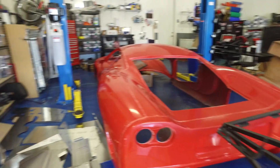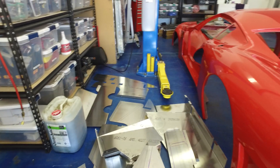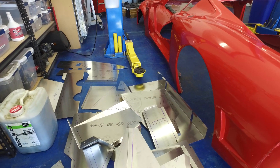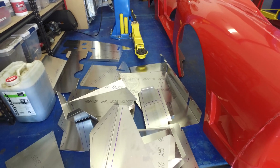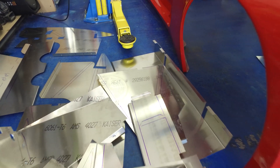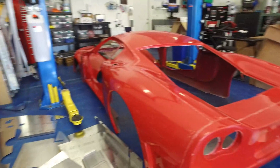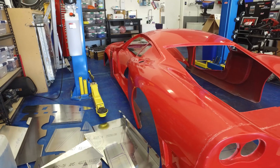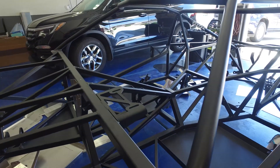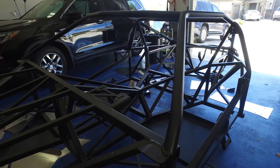What I'm doing right now is getting ready to rivet all of the panels. These are going to be painted too, so the plan is: drill, get ready to rivet, then clean them up, paint, put them back on the car, and then actually rivet them. I've got some purple lines marking the outline of where they match up to the frame. We're going to pre-drill off the car, put it on the car, drill into the frame, and hopefully everything lines up properly — then it all comes back off for paint.